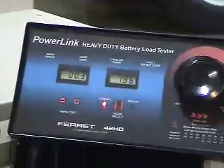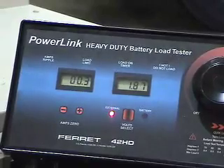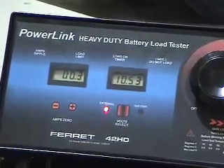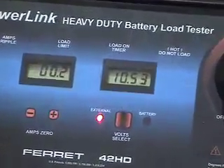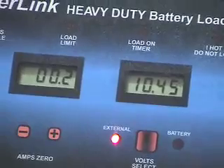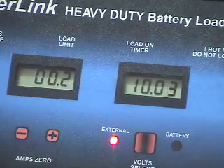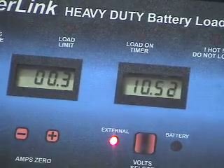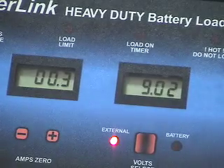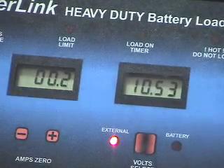If you watch and note on the battery — I'm going to move the test lead from the positive side, moving the negative test lead across to the negative connection on the battery. As you can see on the tester, at one particular point we're losing 10.53 volts. As we continue across, it's climbing: 10.44, 10.45, and there we've dropped down to 3.90 volts. Continuing across, it changes dramatically as we move across, until we get back to the negative connection, where it's dropping to 10.53 volts.